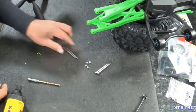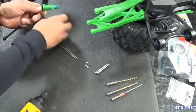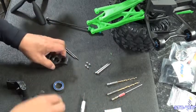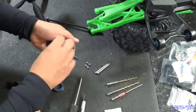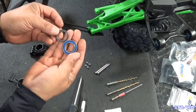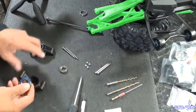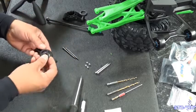Now we're ready to put those right back in — that's done. Now we're going to go ahead and change out our rear knuckles. It just slides right off. Let's compare with the RPM — let's open up our RPM rear knuckles. Let's go ahead and pop the back bearing out — we're not going to use it, we will use the front one. Look what you get with the RPM — it's just huge, a lot more stout. What happens with the stock one is the first time you do a good size jump and land it funny, you end up blowing that little black seal ring out of there. Pop your back bearing in and your stock front bearing gets reused.